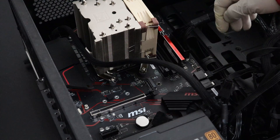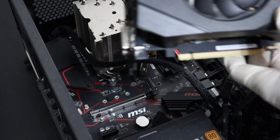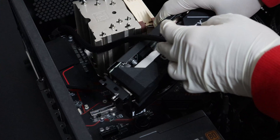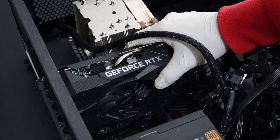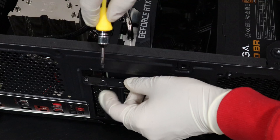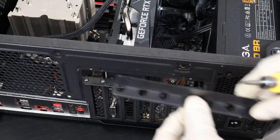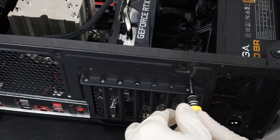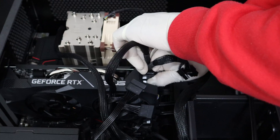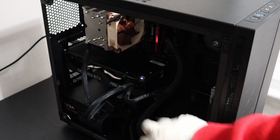This is the x16 slot I'm going to install the graphics card into. The first step is to release the GPU lock. I'm going to send the card below the CPU power cable and then insert the graphics card slowly into the slot. Next I'm securing the GPU into the computer case and installing the side bracket. As a final step I'm installing the single 8-pin power cable. The graphics card is properly mounted and there's an LED light indicating the power cable is properly connected.